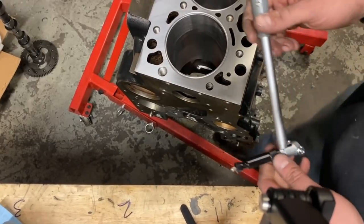All I was trying to do was show you guys how tight the bores were. Basically you jam a feeler gauge into the bore, drop the piston in, and the feeler gauge that you can barely just get the piston down through — that's going to be about half a thousandth more than that feeler gauge measurement. Again, it is not accurate; it was just a way to demonstrate how tight the bores were. So let's take this opportunity to show you guys how to do it right.